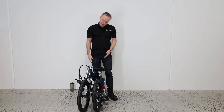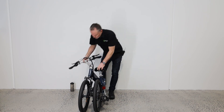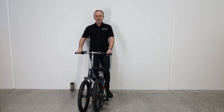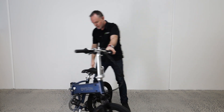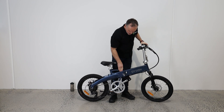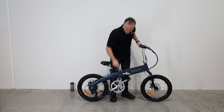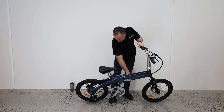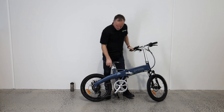So that's how to fold the bike. To put it back together is just the reverse. So we put our handlebars up — make sure that's locked in. Again, rear brake. And we just walk the bike out. You can see with the rear brake on it doesn't want to move. Lock that down, little lever shut. Fold our pedals out — they just fold out, you don't need to hold the latch. And we're ready to go.